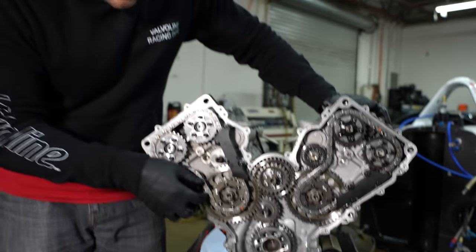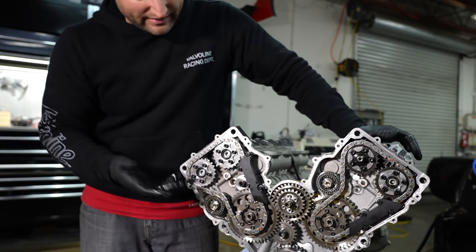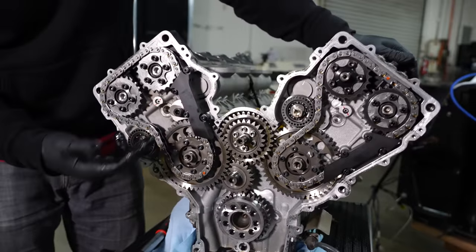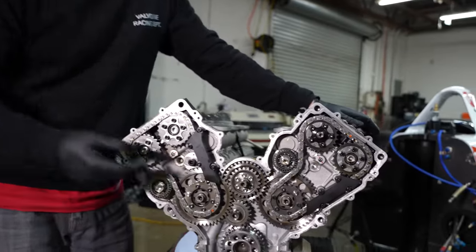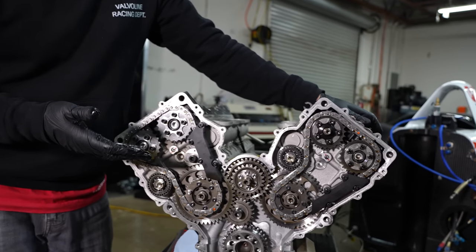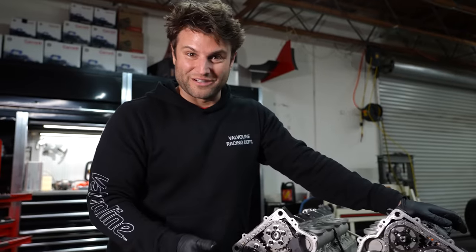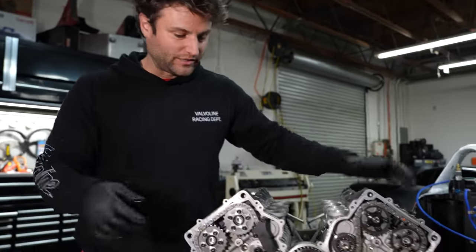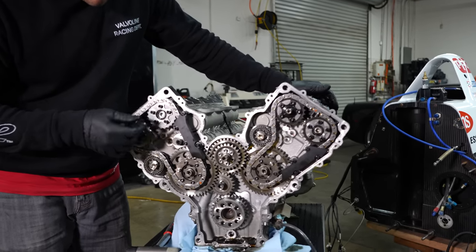It always cracked me up because technically there's a little slop, but at the end of the day it's clearly effective for almost billions of motors. This is both chain driven and gear driven. Instead of like on my old Pontiac Sunbird where it was a belt driven motor — the timing belt was rubber, which broke. Then your valves don't move, the engine is trying to spin, you can't get air in or exhaust out, and of course your motor grinds to a halt.